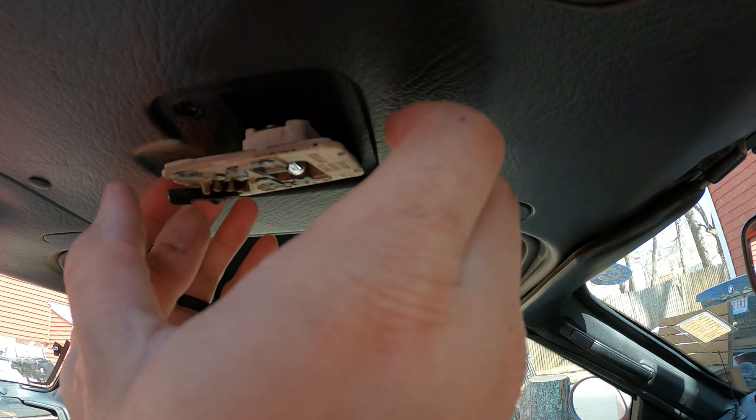It just comes out. Because my doors are open, I'm expecting to have 12 volts here. I'm just going to use this little voltage tester — I should expect the 12-volt light to light up, and it does. There's 12 volts there. Let me wiggle this — there we go. 12 volts is present. I'm going to plug in the new light.